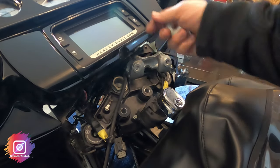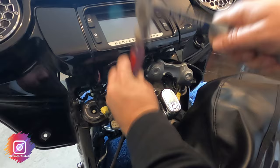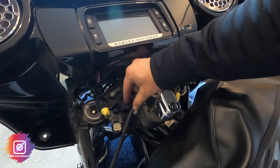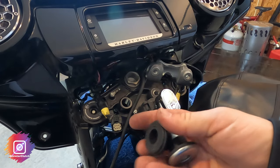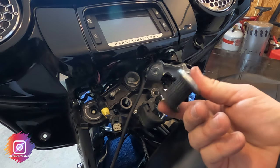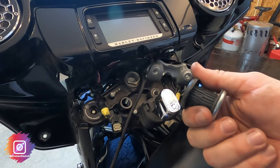There's a cup washer on both of them, one on the bottom, and here you see a spacer. As you can see, these are rubber bushings. If you don't have your fender covered, it's a good time to do it. Here is the spacer coming out — rubber bushings on top and bottom with the spacer in between. If you've never changed them out, this is what it looks like: rubber bushings, spacer, and two caps. You won't need any of this because when you get the new polyurethane bushings, it's just top bushing, bottom bushing, and the bolt.